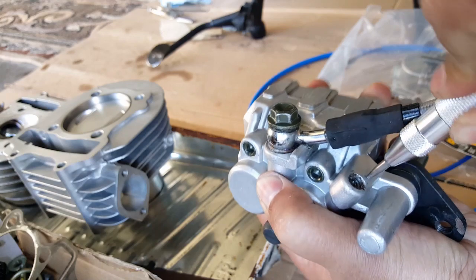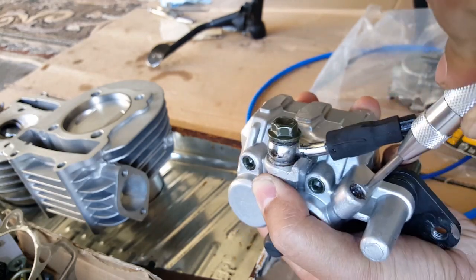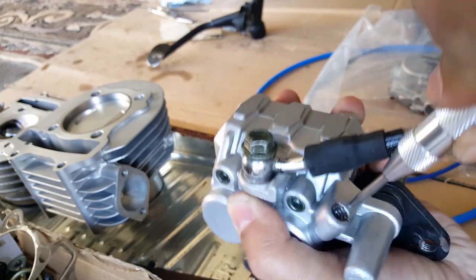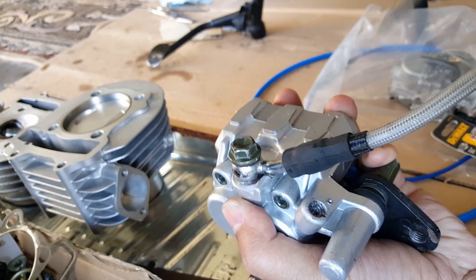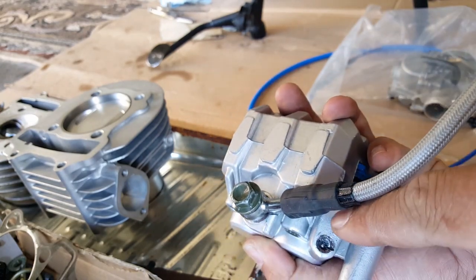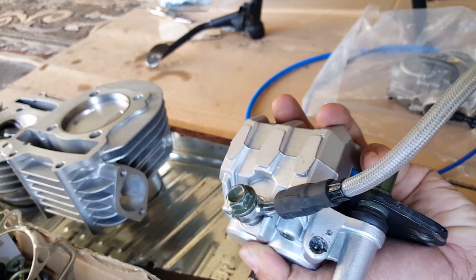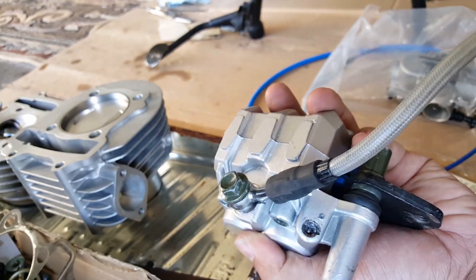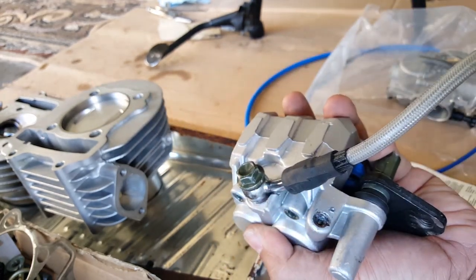See that? Now this is soft aluminum too, but it still does it to metal. See how it goes deeper and deeper? Now it's not going to poke a hole through it for you, unfortunately. But you can see there, that's enough to tell your drill bit, I just want you to focus on this diameter, and it'll anchor it all the way. And then you can drill easily, especially on a round surface like a handlebar. You've got to definitely get one of these. It makes your job so much easier. It takes less than 2 minutes, to be honest with you.